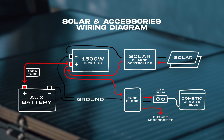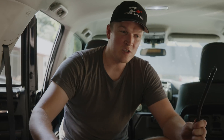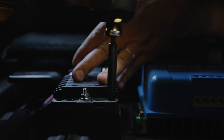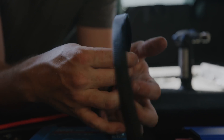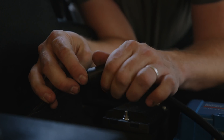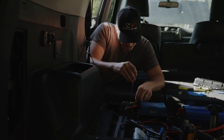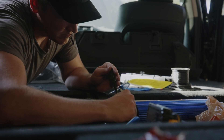This two-gauge wire is going to deliver all the power we need to this 1500-watt inverter. The biggest thing you want to consider when doing this at home: the longer the run, the thicker gauge wire you need. There are charts online — we just Googled one and determined that over 10 feet, two-gauge wire for a 1500-watt inverter should work. We spent a lot of time researching inverters for this project and found that you really want a high-quality pure sine inverter. We went with a 1500-watt pure sine inverter from Amazon — we'll leave a link in the description. This gives us plenty of power to charge laptops, iPhones, camera gear, and even keep our Dometic cooler running all day.